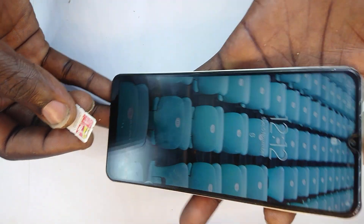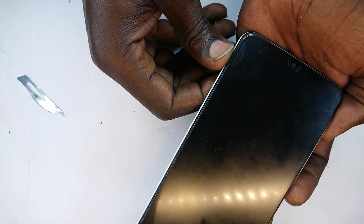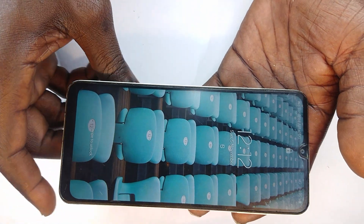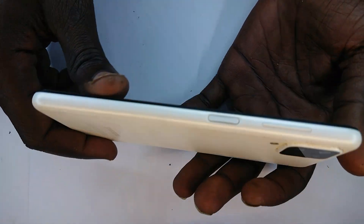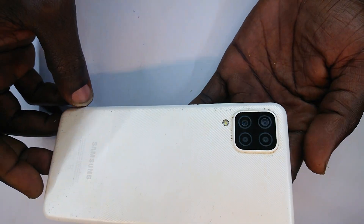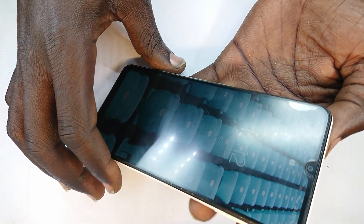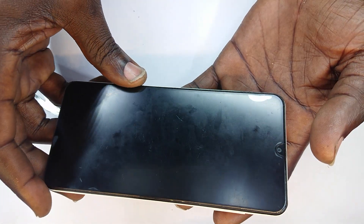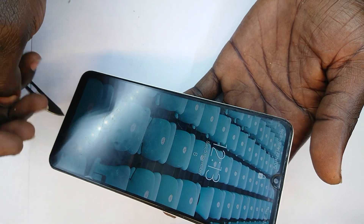The double tap to wake works, and that's this guy's salvation that he had enabled that. Otherwise, waking up the screen would have been a nightmare. SIM card placed in. So that's it for today — in this video I've shown you: one, how to take apart a Samsung A12; two, how to power it on in the absence of a power button; and three, make sure you set double tap to wake up the phone in case this ever happens. Those are things you thankfully had enabled before your power button died. The only remaining task is ensuring the phone never blacks out.